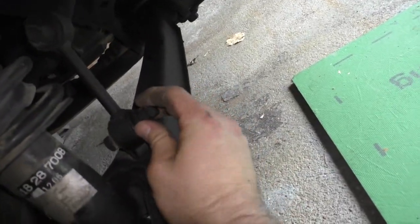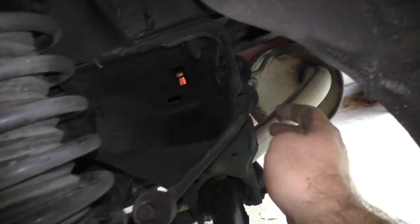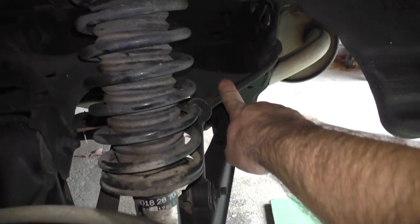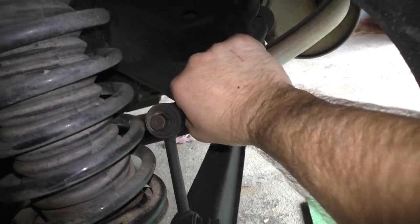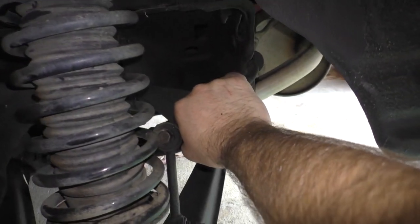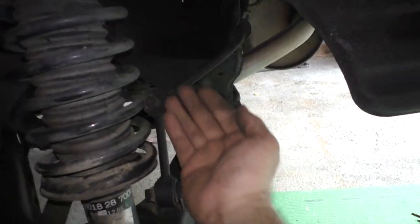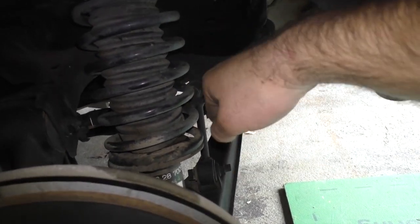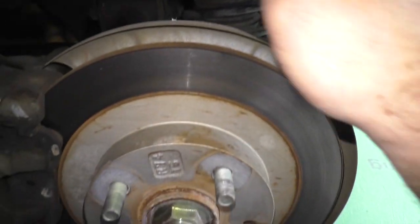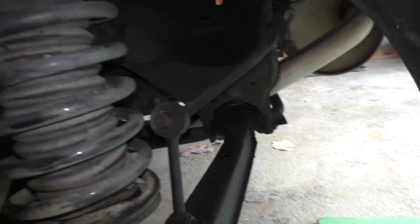Even these links - I'm gonna replace the links, just because I feel it's the right thing to do. Right now this bar should not be under any tension because the car is in the air. This right here is your anti-roll bar or sway bar. Its job is - when there's a difference in position of the rear end, let's say this side is being pushed up as you're coming into a corner - it's gonna push up on this torsion bar and pull up on the other end, to try to compensate for that movement and counteract body roll.